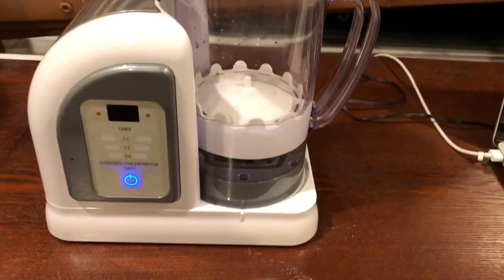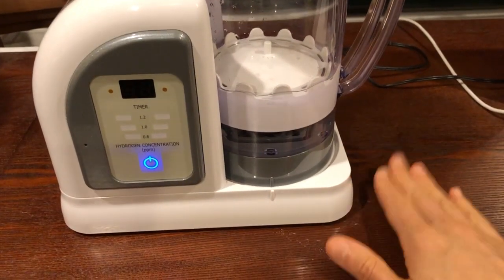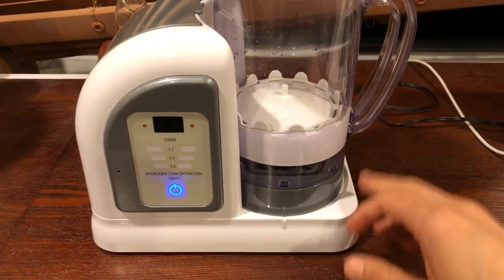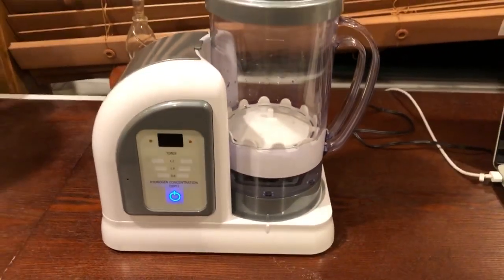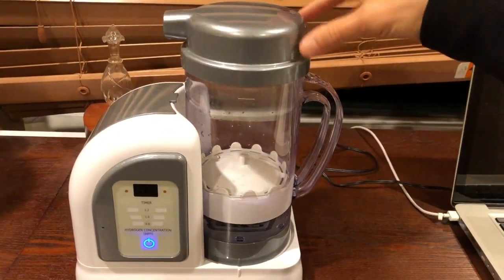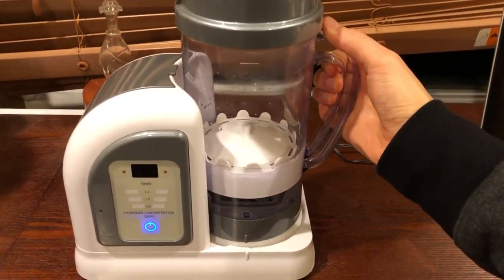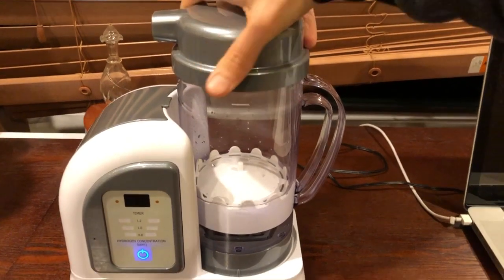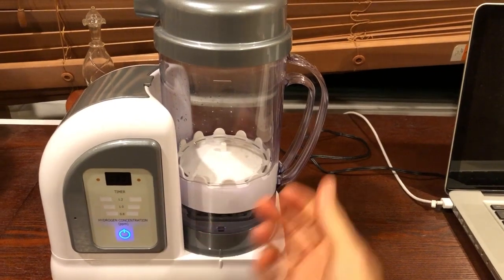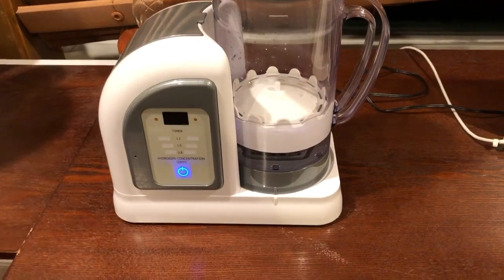Never set the device on anything like a towel — just leave it up against the counter because you want that airflow underneath it. Don't overfill it, don't spill water around it, and don't leave the rubber plug out. If you're ever going to swap the top out for the inhalation device, or just take the top off to refill it, make sure you lift the pitcher off the device first. Don't have it sitting on the device and then grab the top and twist it, because you'd be yanking the pitcher sideways and it can damage things underneath.